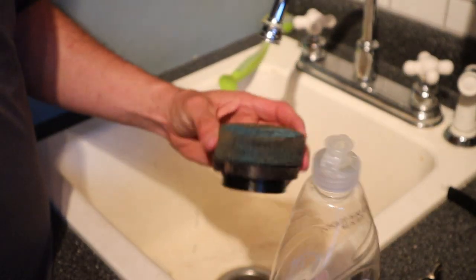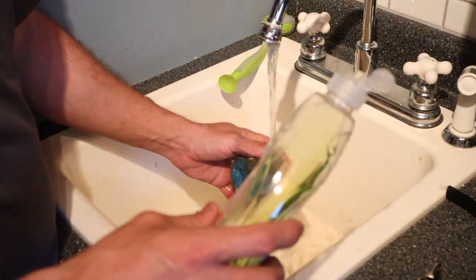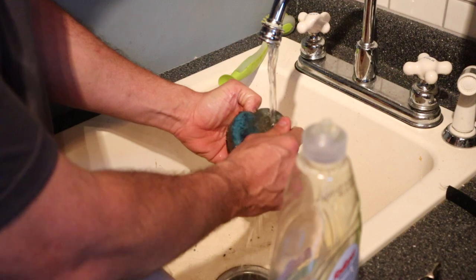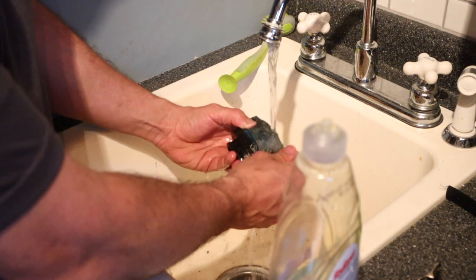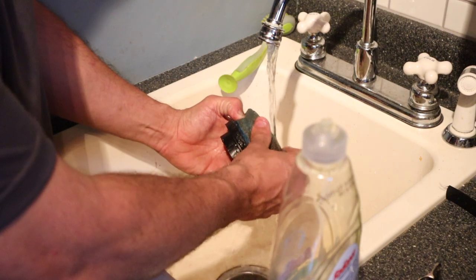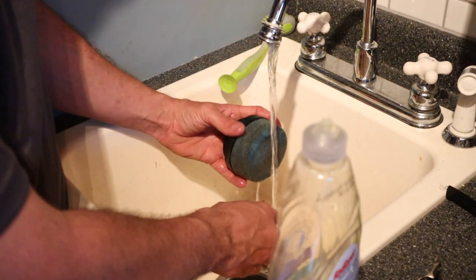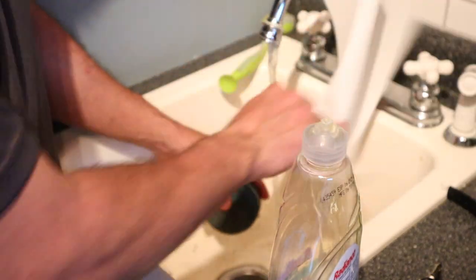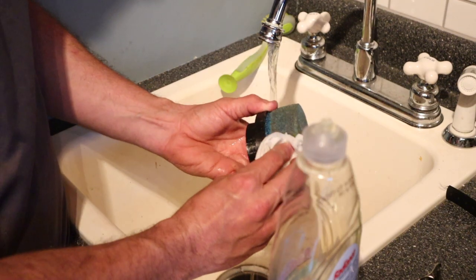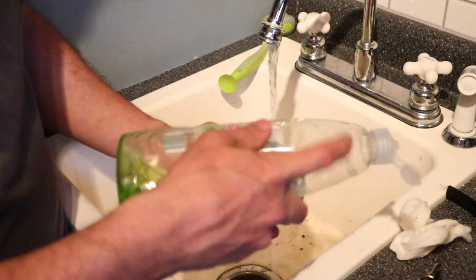Now that we're inside let's go ahead and clean this bad boy up. I use dish soap — you can use Dawn dish soap, this is some cheap stuff from Radiance. I literally just start soaking it and getting the clumps of dirt off. Most of the time your large particles aren't going to go into the foam, so you don't have to worry about it getting into the fibers. Just start wiping them down. Obviously it's an oiled filter so it's going to be a greasy mess — that's why I'm doing this in the mop sink. Another option is to take a paper towel and literally just wipe it down, which will get some of that greasy, oily texture off so you're not getting it all over your hands. But the best thing to cut the grease is obviously the dish soap.